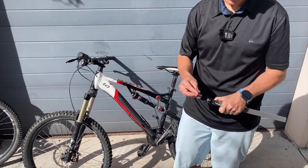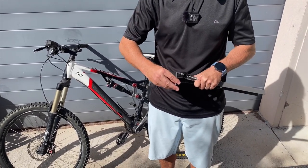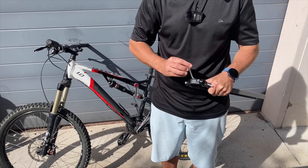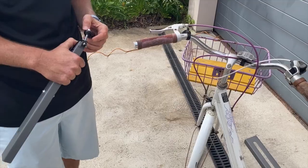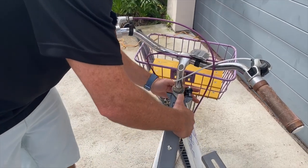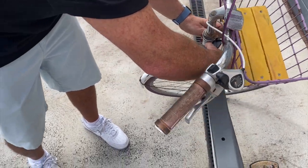The first thing you do is undo the bolts completely on one side — this is easy to do because the nut is locked in place so you don't need a wrench. Once you've undone that bolt fully, you then loosen off the other side. We've removed the bolt from one side of the bar and loosened the other side, and now we attach to the headset. On the ladies step-through bike it's very simple, then we tighten the bolts up and join the bar together.